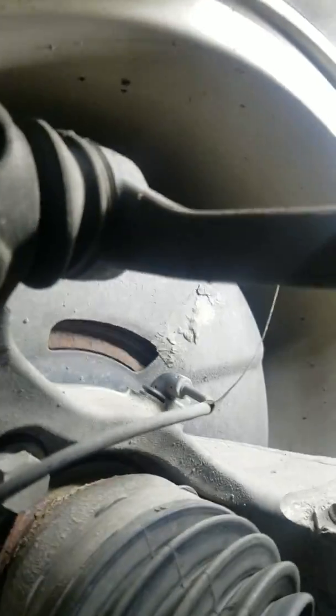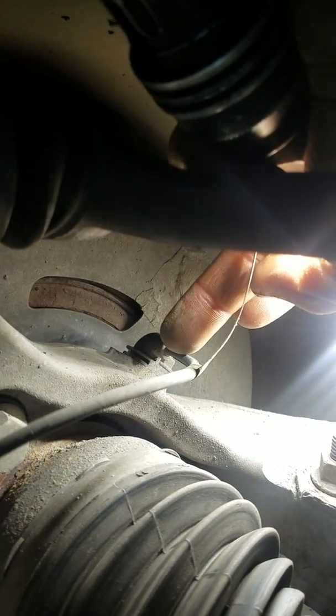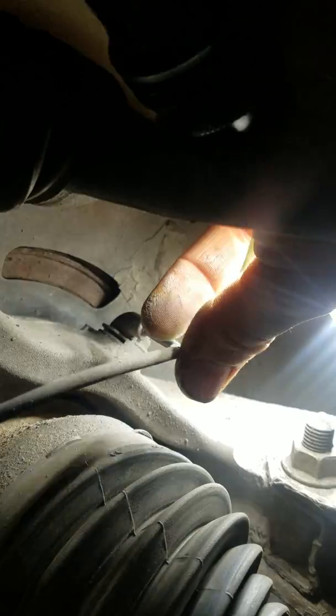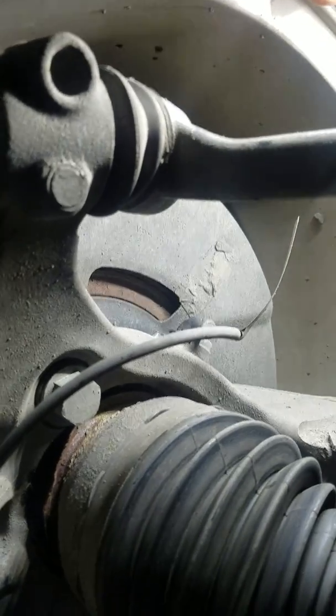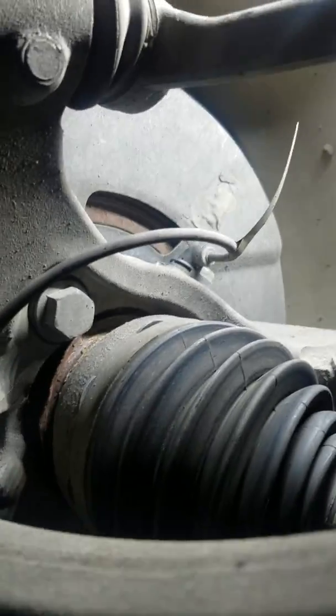This style is different from the one where the wire normally corrodes. This one has a solid wire all the way through. The older ones have the wire on the wheel bearing, but the connector comes up here, sits on a silver bracket, and then the body harness connects onto that. The wire corrodes on the body side — underneath the conduit it breaks. You can either fix the wire, solder it, splice in one, or just replace it.